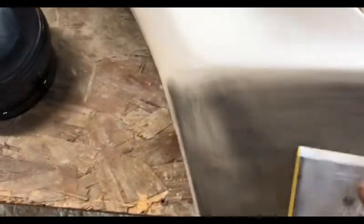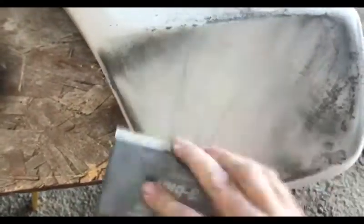And as you can see, it shows up our sanding scratches from our 180 grit. So I'll use my little block, and then we'll sand my crosshatch pattern. I'll give it a blast with my air hose so we can see where we're at. Sorry if I'm making you dizzy. Still got a little bit more to go. But when this is sufficiently sanded for the stage, it will show no more guide coat, like that area right there.